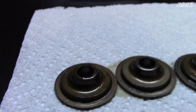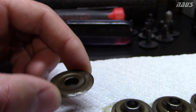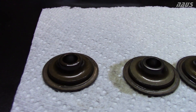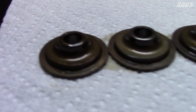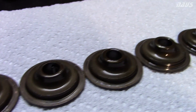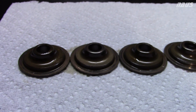This piece is the intake retainer for the valve spring — the valve spring sits downward and the retainer is known to crack around its lower edge, which faces down and you can't see it until you pull them off. You're not going to really be able to tell if yours are cracked until you get them off the car. I could have left the originals on and it would have been fine, but the AP2 retainers are in there now — they're a lot stronger.